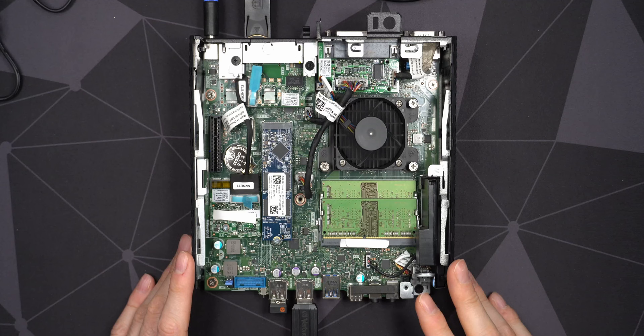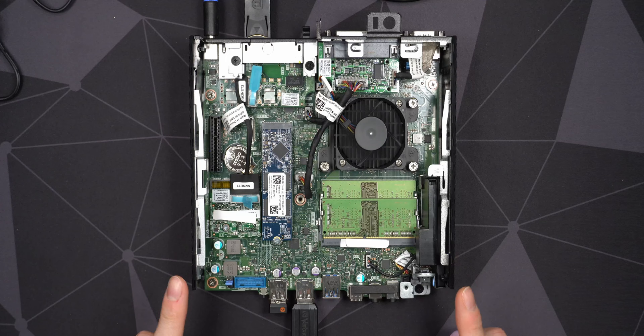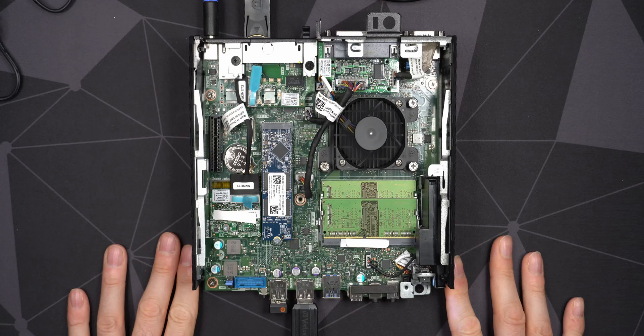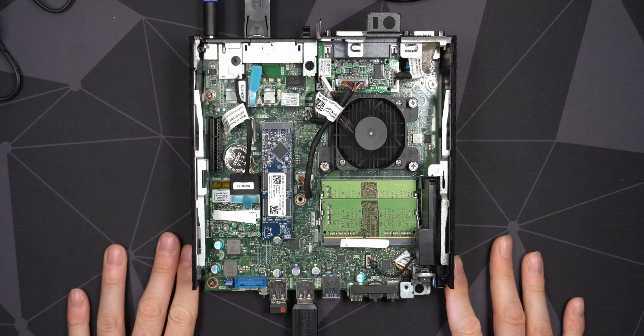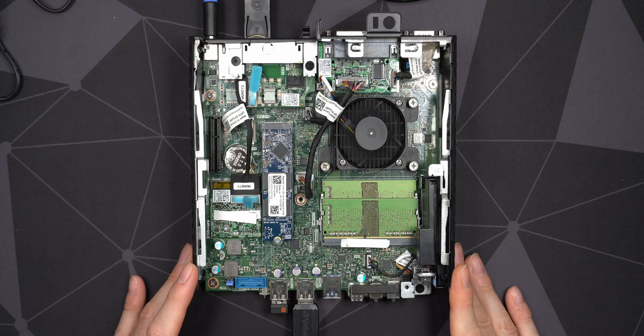So this has been a hardware overview and BIOS walkthrough of the Dell Wyse 5070 Extended. I definitely recommend it — just be prepared to pay a bit more for the extended version, especially with dual NICs built in. In Europe they're hard to find so I had to import mine. I plan to run pfSense on it plus maybe OPNsense. It's super nice to work on, relatively quiet, uses very little power, and for a 24/7 web server and firewall I'd rather trust Dell's build quality. Links to eBay listings in the description if you're interested.